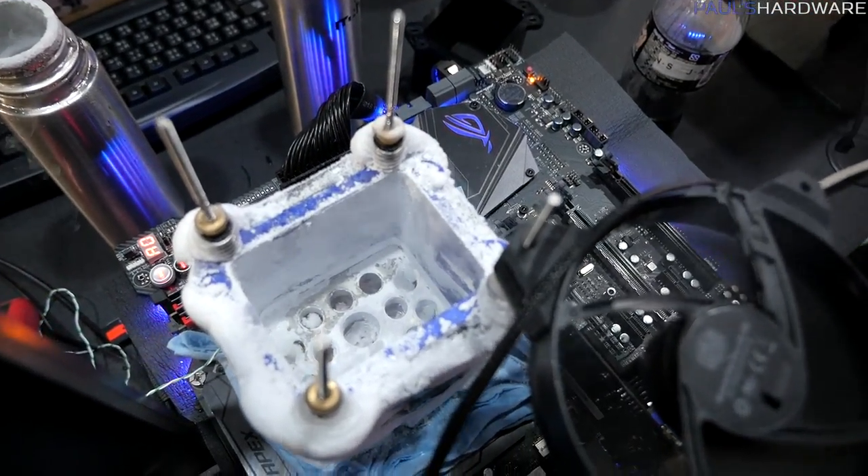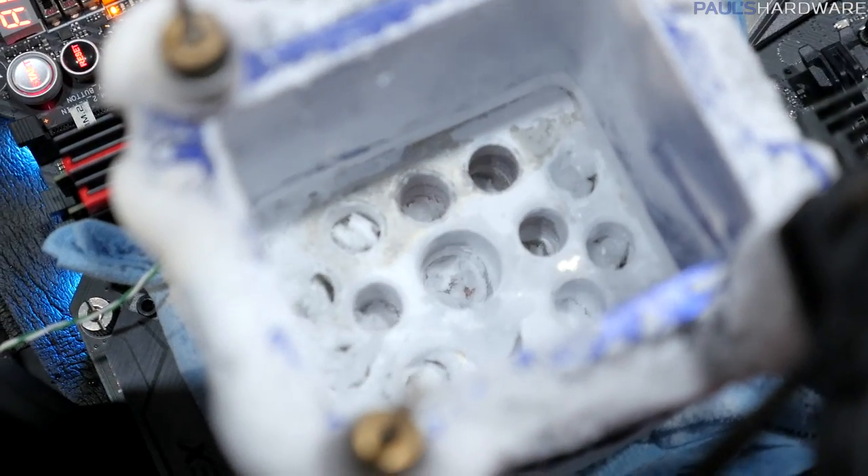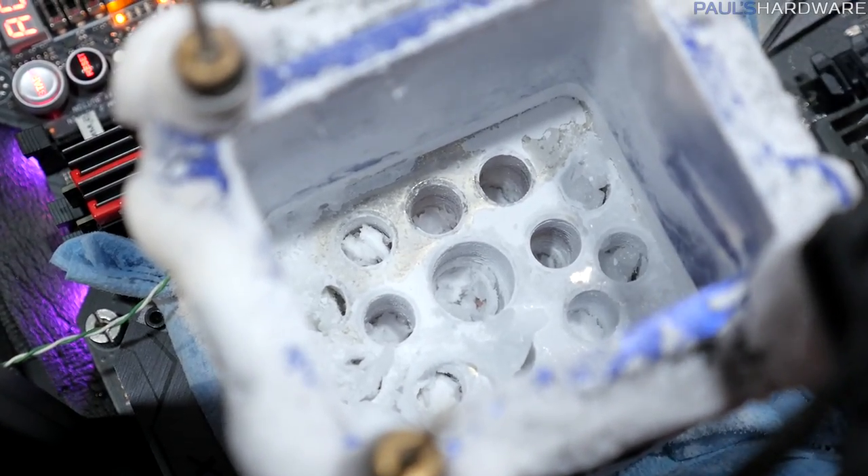That's all you need to know before you start pouring in. Right now we have a 7700K at 5,500 MHz. The CPUs have been de-lidded, the crappy thermal paste that Intel uses has been replaced by something much higher quality, lid goes back on, more thermal paste, pot sits on top. We're actually at 1.6 volts right now — CPU-Z is not trustworthy at these extremes — so hitting 5.5 at 1.17 as reported would have been a very nice chip.